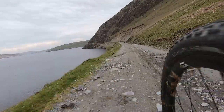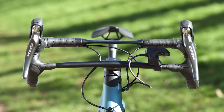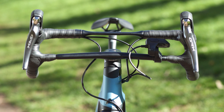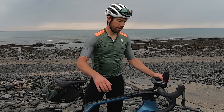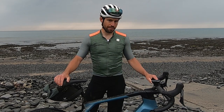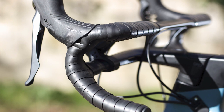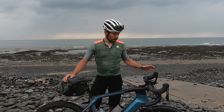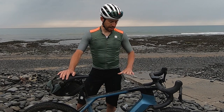To sum up and review the bike — negatives first. I'm still not a convert to this hover bar or biplane bar. There's potential extra comfort on the tops, but I could probably count on one hand how many times I used that section. When you need control you need access to the brakes, so your hands aren't going to be in that comfort position. The cables are also pretty messy, and it's got less flexibility if you ever want to adjust the setup. Personally I prefer a normal bar.